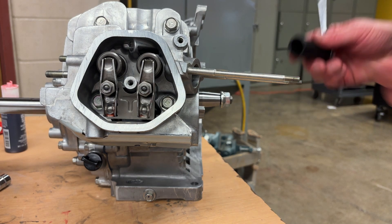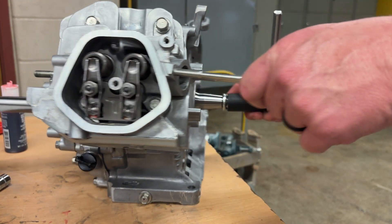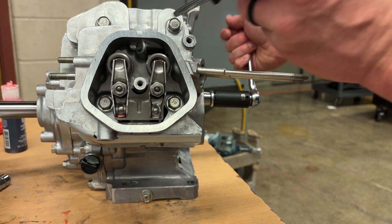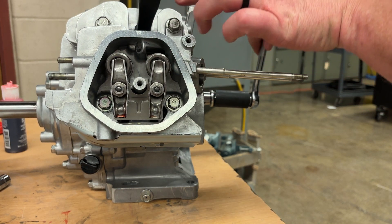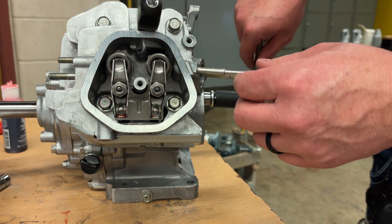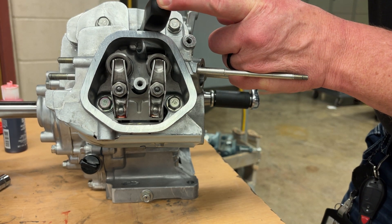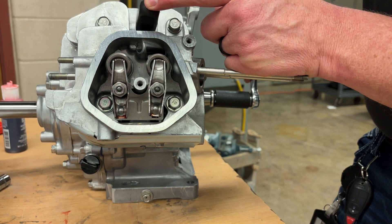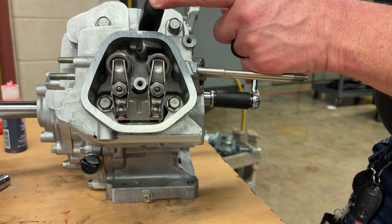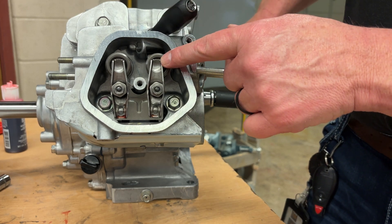I took that 23mm socket, put the nut on, and now I can turn this and see what's going on. I'm looking straight down the spark plug hole. I'm watching as the piston comes up — I'm putting the screwdriver in there. Don't put something that can fall in, because then we'd have to rip the whole engine apart. I'm looking for top dead center on the compression stroke. The intake valve was just open, now I'm coming up to the compression stroke — right there is top dead center on the compression stroke.